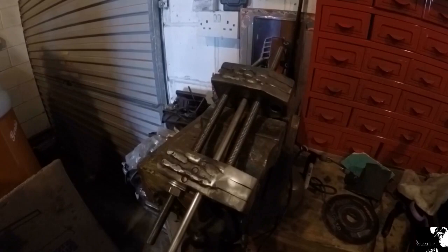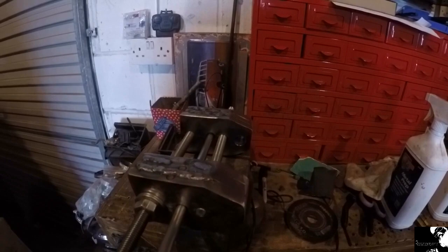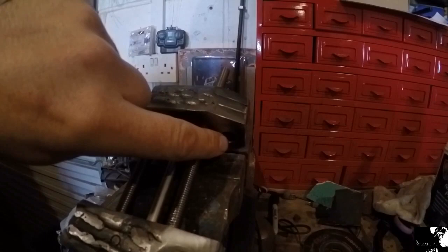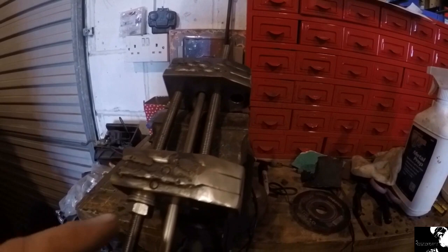It's now looking a lot like the concepts you see online for this tooling. Just got it back from my dad's place where he was able to use the pillar drill to get some more accurate holes drilled through. I've got a 13mm hole up on the top section to clear the threaded hinge pin — because the '67 Beetle has wing mirrors that actually screw onto the hinge pin itself. I've got an 8mm centre bar just to hold everything in its place.